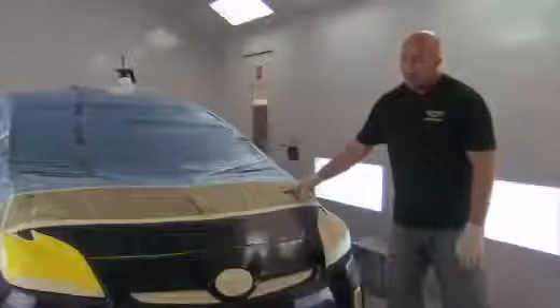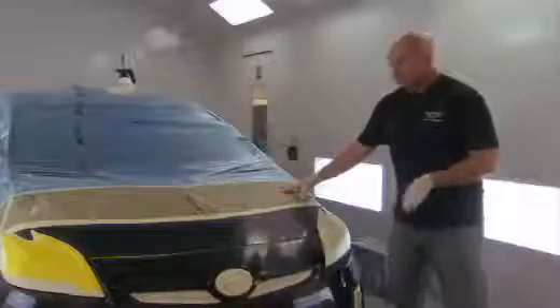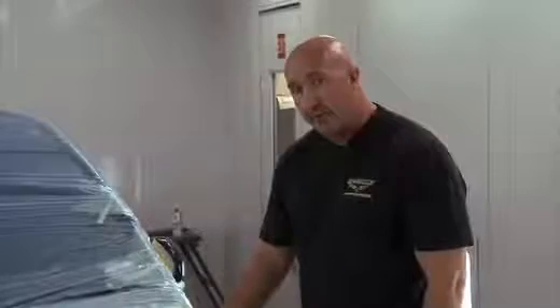To spray Armor Coat on a vehicle, we have prepped it as we would prep it for paint. The car is already masked. We have a tape line that is set up to back-tape the fill on the edge of the vehicle so we can pull this while the product is still wet. This gives a uniform line and lays over top of itself so we don't have a rough edge.